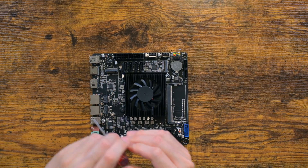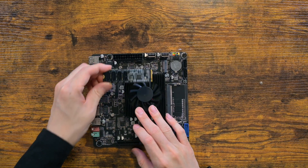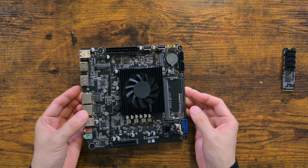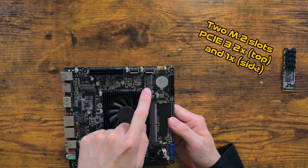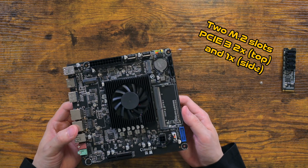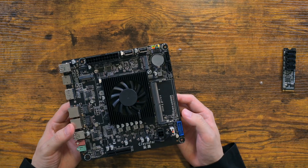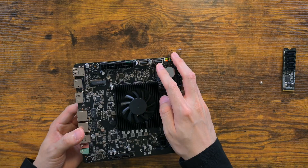Anyway, once I overlooked that, I found something interesting — a potential. It has two M.2 slots. It's quite rare to see a motherboard based on N100 have two M.2. These two are in fact NVMe PCIe 3.0 x2 and x1, which I will show you later. What this means is that this motherboard can be used as a media PC with an OS disk and a storage disk in a small package. They may have advertised this as a NAS motherboard, but I saw its potential as a PC motherboard with two M.2 slots.